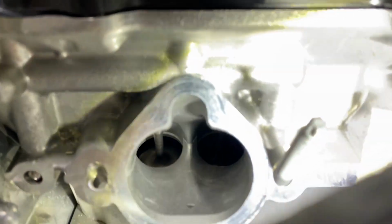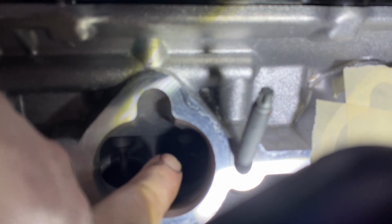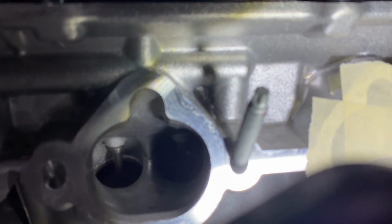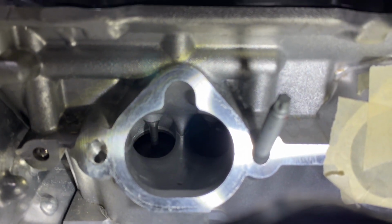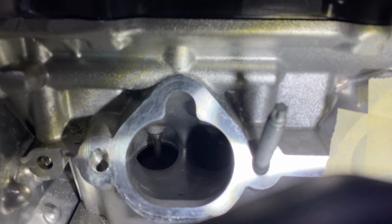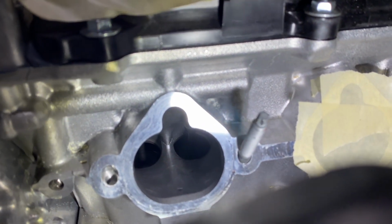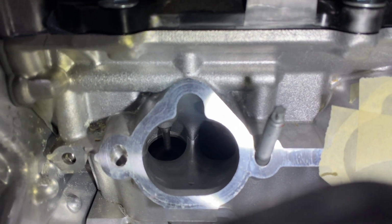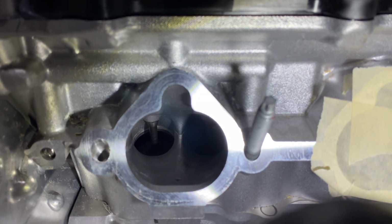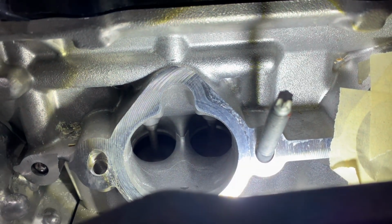It's got a dedicated chamber for each valve. So a dedicated one that runs this way and one that runs that way instead of just the flat bottom like the Series 1 has. And then instead of that flat wall, we actually have a very sharp-edged, segregated area between these valves. Now, I know I'm not using a borescope and it's not as clear on the camera, but just look at this. Very, very well designed. And then look at this. Better port design on the intake side of the heads.